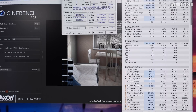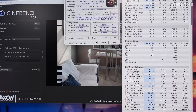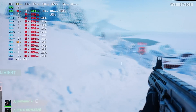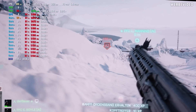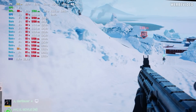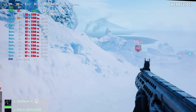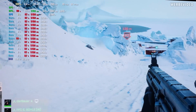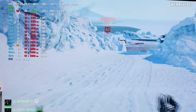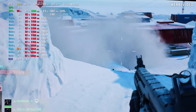Running Cinebench R23 — a 7600 doesn't consume as much power, about 90 watts during load. Still, we see about 85 degrees Celsius. So it's definitely capable of keeping the CPU cold enough to not lose any performance. This is quite a lot better than I expected. The CPU is maintaining around 80 degrees Celsius while the clock speed is much more stable and higher than before — about 100 MHz higher on average and almost 10 degrees Celsius colder. Maybe not as good as a modern AIO, but totally usable with no performance loss.